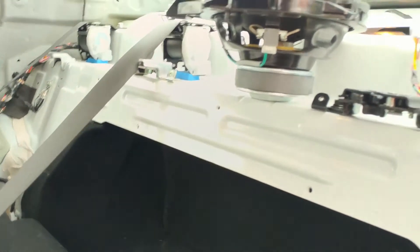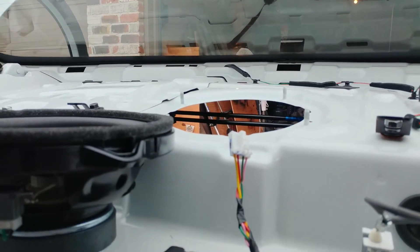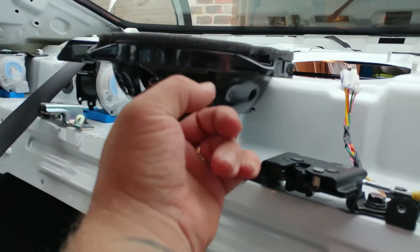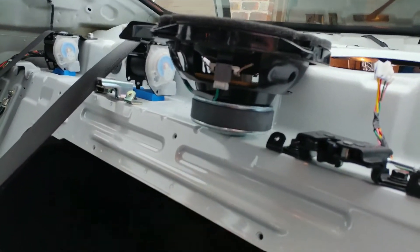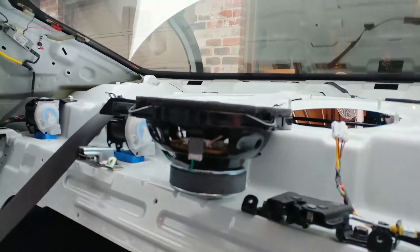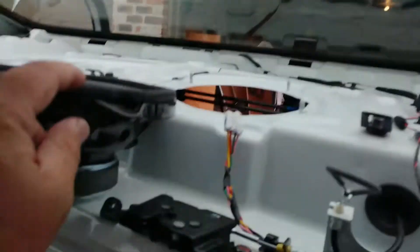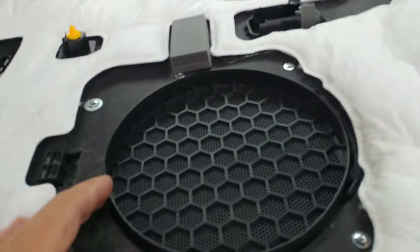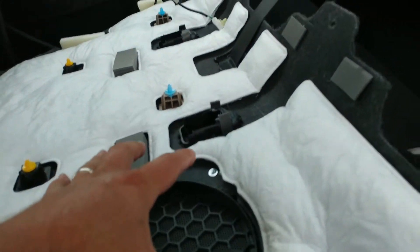What we're doing is pulling that out because the 15-inch subwoofer we're putting in the back — the airflow is just gonna shred the coil on this little factory sub. This has the Infinity system, or the JBL — it's gonna be the same thing. So we're gonna leave that open and put a foam piece around here similar to what this was, that will touch the grill, to fill in that gap.